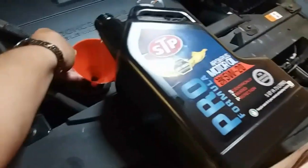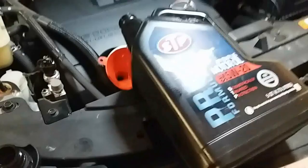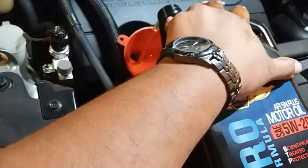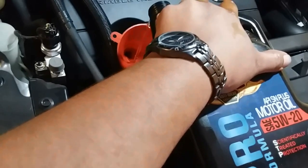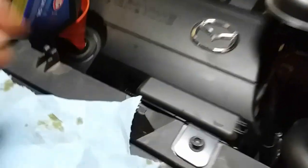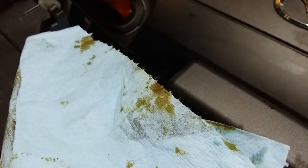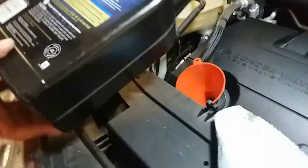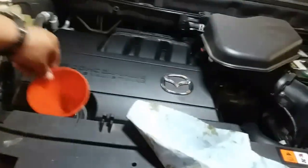Look at that — filling itself up. Now we'll drain this a little bit more. Let's go ahead and fill it all the way up. Pull out our dipstick, wipe it, stick it back in. Sweet — it's nice and full, right at the second line. This takes five quarts. Nice to know. And that is how you complete the oil change on the 2011 Mazda CX-9.